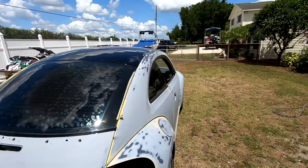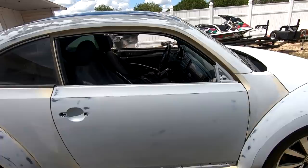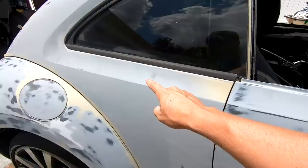First thing we're gonna do is we're gonna spray the white. So the white's gonna go all the way around here. And also gonna spray the door handle separately, that way they get full coverage. And then we're gonna tape the white off exactly how the body line is. Then we're gonna spray black, because there is a black pinstripe that separates the tan and the white. So we're gonna paint black, then we're gonna tape the black pinstripe off, and then we're gonna go all tan.